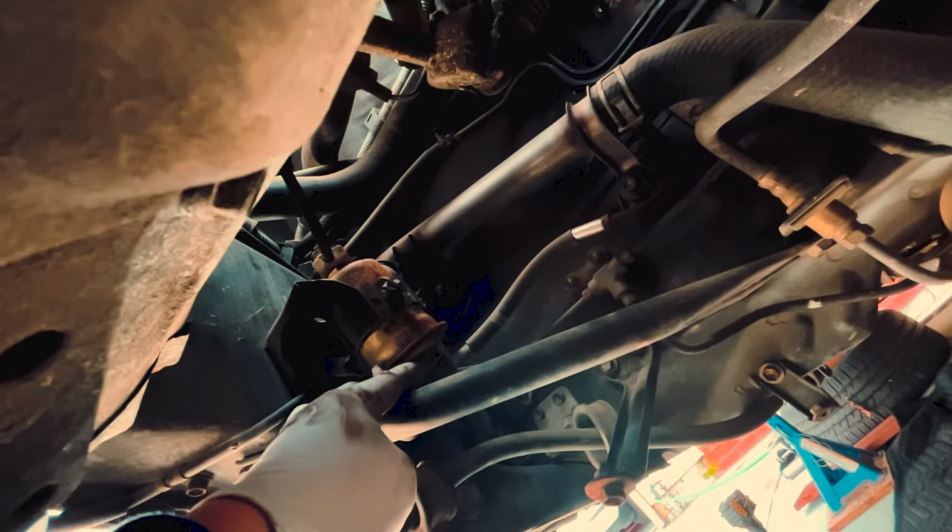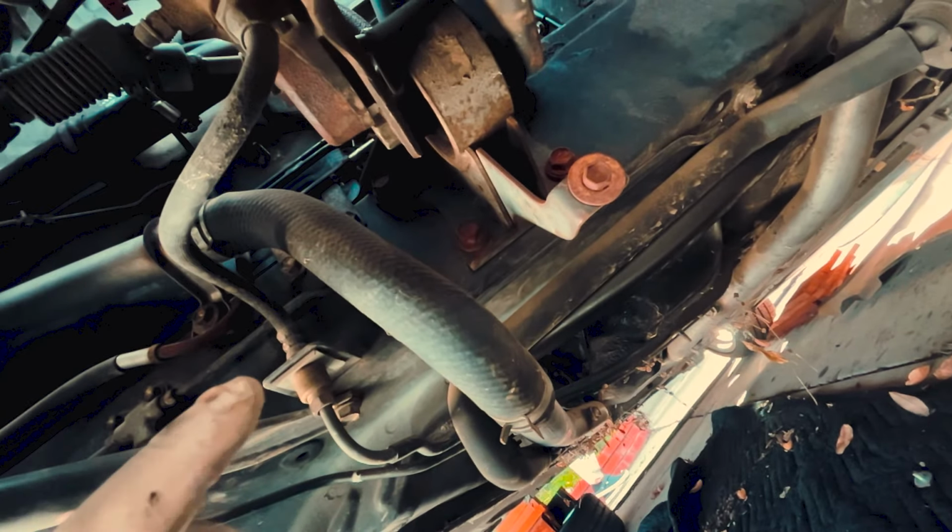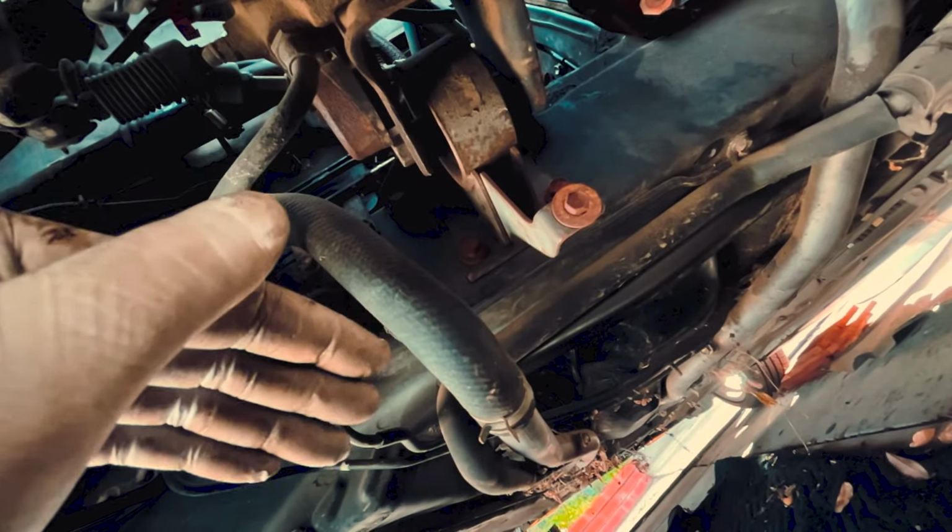Okay, so I'm here at the bottom of the car. This is the fuel filter. I'm gonna disconnect that at the bottom of it, and then whichever bracket, I think these two 10mm right there, unbolt that. That should loosen up this whole section of the fuel line. Maybe I have to undo this one too because it's kind of in the way. I have most of the line on top detached, but it's so old that they're kind of stuck. So I think I'm gonna start dropping the tank and hopefully use the tank as it drops. It's gonna pull against the line, without damaging it, of course.